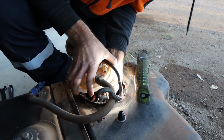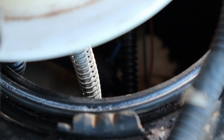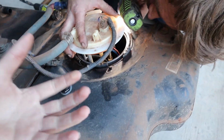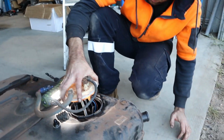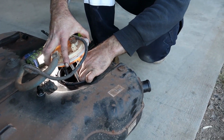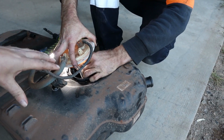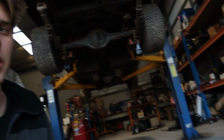It's a bit hard to see, but you can see our fuel hose at the back there. And that just goes down into the pot to ensure that the fuel returns into the pot so the pot stays full. So this is just a dummy fit to make sure it's all going to work. Still got to hose clamp everything, but it's looking pretty good. So that'll sort of be the circuit of the lift pump to the surge tank.